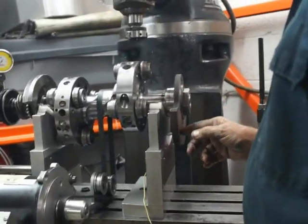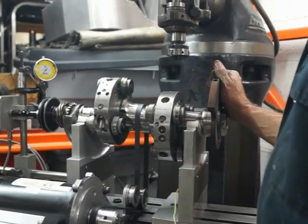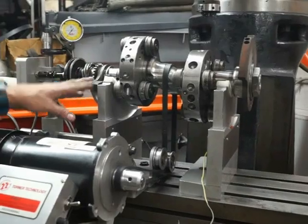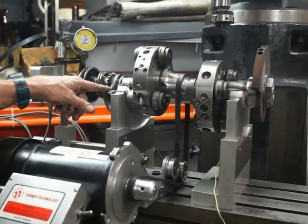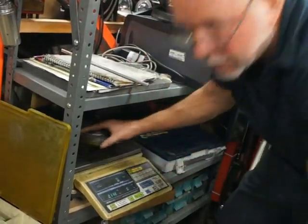So that rotor weight, it's heavy right here. Instead of being heavy here, it's heavy here. Meaning that there's not enough weight on this side to balance this mass. And on this side, I've got the same problem. The heavy spot is here, which means that I don't have enough mass to balance on this side to balance the weight that's over here. So this is the lighter weight rotor counterweight. I'm going to go ahead and put the other one on. This was 1890, I got 70 grams here, or 64 grams heavier here.